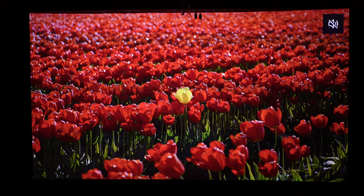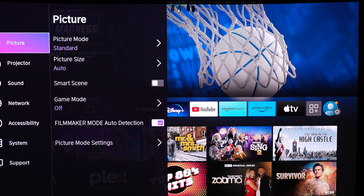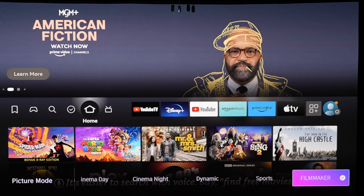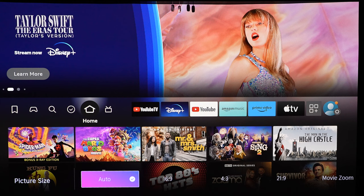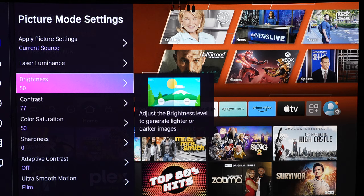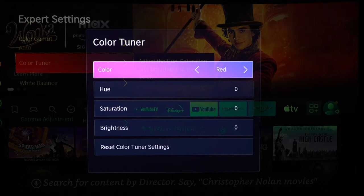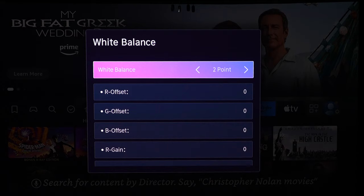The C1 has an eye protection mode with a front sensor — if you walk in front of the projector, it lowers the laser light and eventually turns it off so you're not staring into the laser. Hisense touts 110% of BT.2020 color coverage, giving a lot of color volume and saturation. There are multiple picture modes including filmmaker mode, plus extensive calibration controls: gamma, color gamut, laser luminance, and a 20-point white balance scale to dial in accuracy. The projector also supports Apple AirPlay and HomeKit.